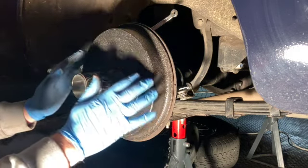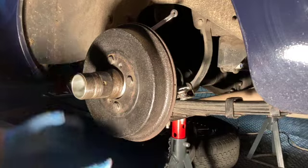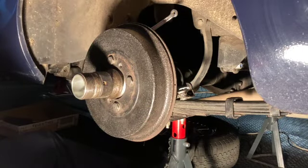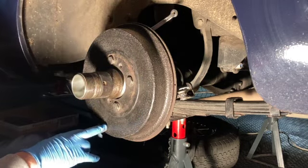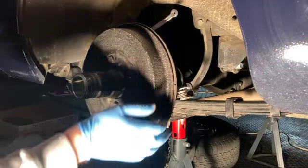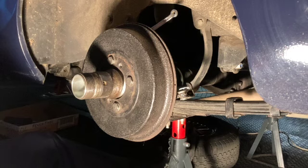All of this you should do really, depending on your mileage obviously, but every year, certainly every 2 years. It doesn't take much to take off the disc, the drum, sorry, at all. But it's well worth doing, because then you can just make sure everything's okay, it's not leaking down the bottom here. That will be very serious for you in terms of putting fluid onto the drum itself, and therefore onto the brake linings and non-effective brakes.